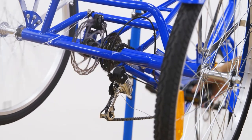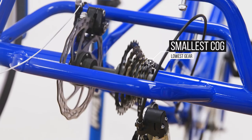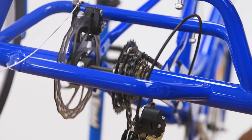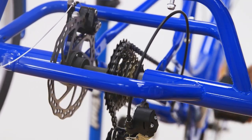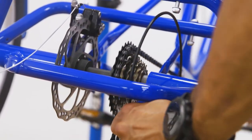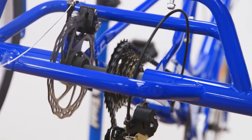We will first start by pedaling the bike freely. If not using a workstand, this can be done by propping the rear drive wheel off the ground. However, as mentioned, we recommend using a bicycle workstand. We will adjust the gears down to the lowest setting so the chain sits on the smallest cog at the rear. Now check each cog by shifting the gears up and down nice and slowly. If the chain doesn't move up the cassette freely, it means our gear cable is too loose. We can fix this by increasing the cable tension on our barrel adjuster. This is the opposite for shifting back down our gears. If we find the chain doesn't move down freely, we have too much tension. Backing off the tension with the barrel adjuster will allow the chain to drop down freely.